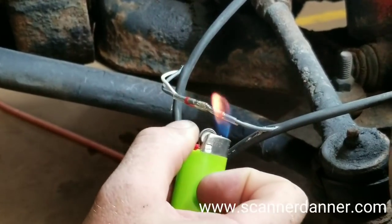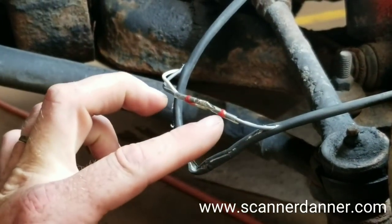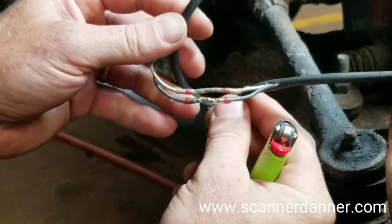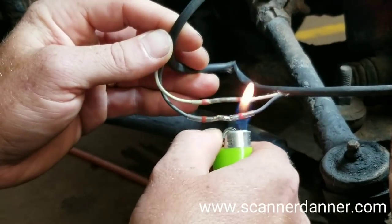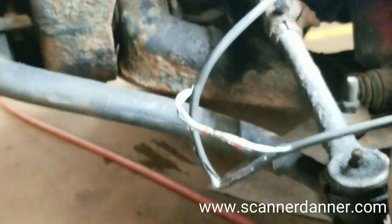You don't need any type of tape just to protect from shorts. What the manufacturer says is the red part on the outside — that's your water seal. And then the solder is on the inside. So not only are you melting the solder, but you're also melting that watertight seal on the outside, the red part. Yeah, that's a good connection in wet conditions.